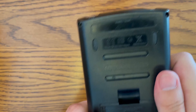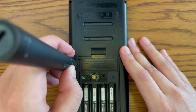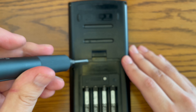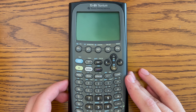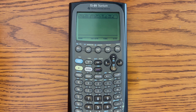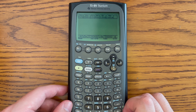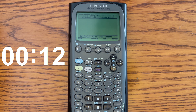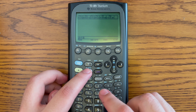We got the graphite on there pretty good. Now we'll just put the backplate back on, snap everything back into place, and screw everything back in — including the Phillips head screw which covers the backup battery. So the moment of truth: we're going to enter the benchmark code again and test how long it takes. It's a lot faster, and doing the same calculations as before, the clock speed we have now is actually 15.87 MHz — a lot faster than before.